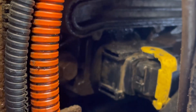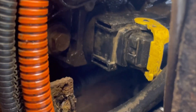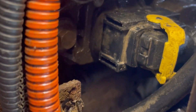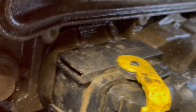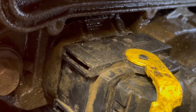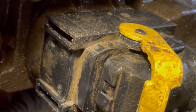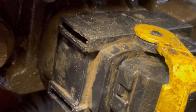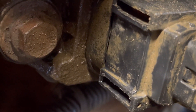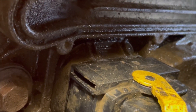We're in the process of trying to check for power, grounds, and communication lines, but unfortunately this connector is not cooperating. We've been working on it for about 20 minutes now and the connector is stripped. There's a stripped tooth about halfway up the cantilever, which is not allowing the rectangular tabs to drop down and release the physical connection of the MCM connector.